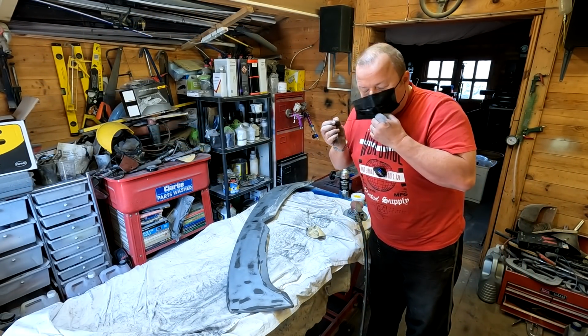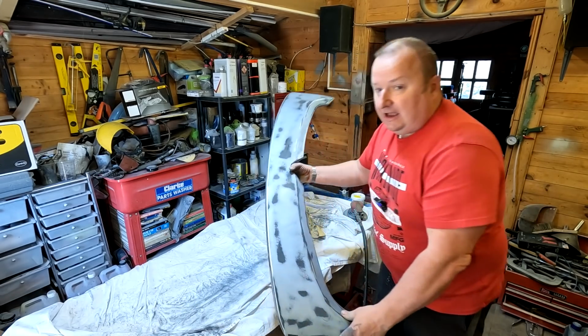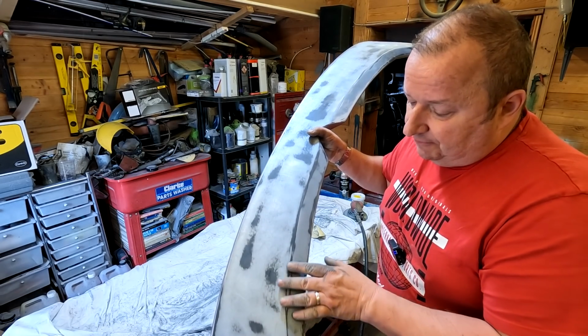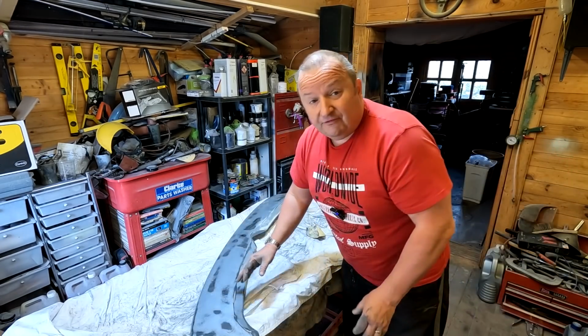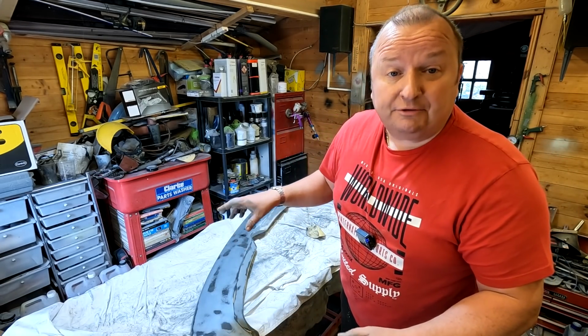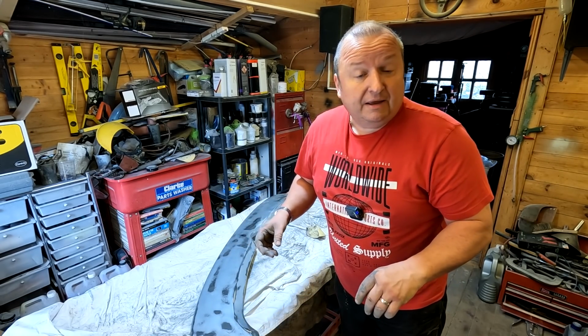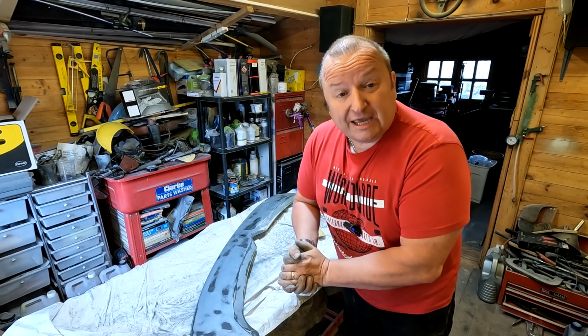Right, okay folks, that's got it down to 500 grit now. As you can probably see in places where it's not been painted properly before, there doesn't appear to be any primer on it, so we're going to have to do a bit of priming on this first of all. Funny thing, Jimmy's just popped out, he's got to do a bumper in here today, so he said provided I can get this primed, he'd spray it for me, do the base coat and the top coat as well, because he's doing a bit of spraying as well, so we'll take him up on that.